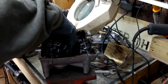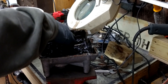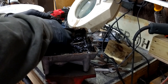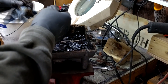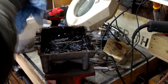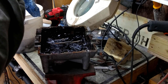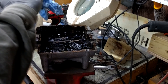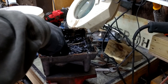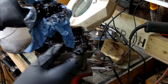What I'm going to be doing is reassembling it with the red tacky grease, and then we will fill the transmission with regular gear oil. I have some that's 80 to 90 weight, and I may get some a little bit thicker than that. Didn't you always want to play in mud puddles like this?